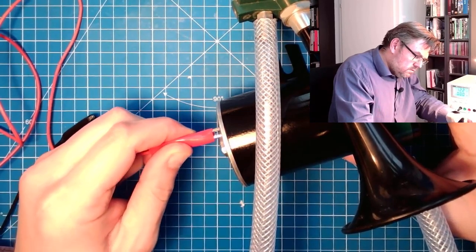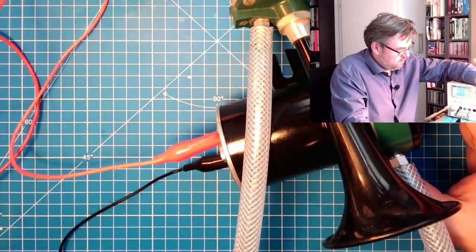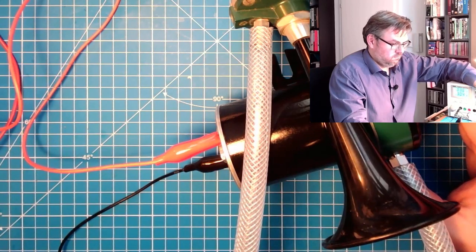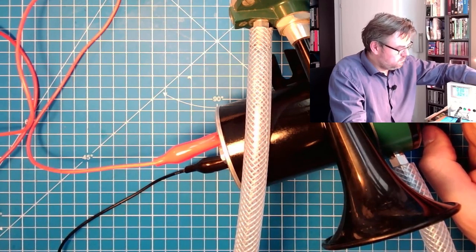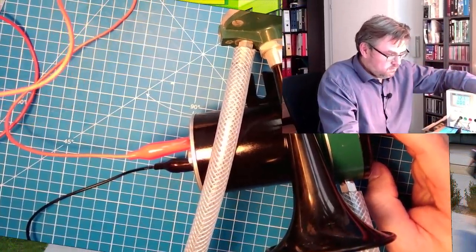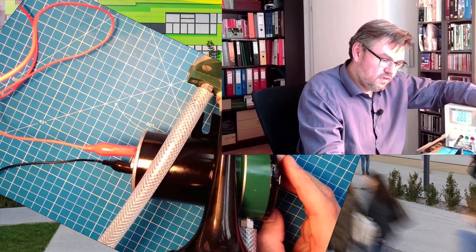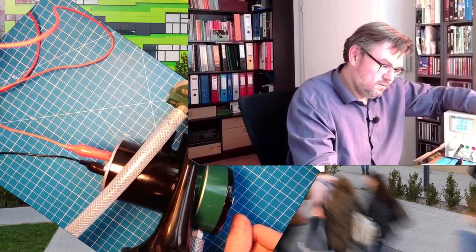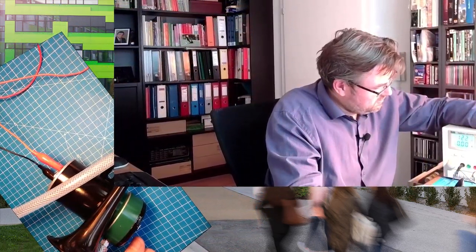Plus, minus, plug in. The same. Yeah, okay. Ah, we learned something. We have seen the DC motor, we have seen the rotary vane compressor, and we have seen that 6 amps is not enough to drive this. So we have seen 6 amps at 12 volts, so 72 watts, too little.